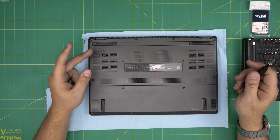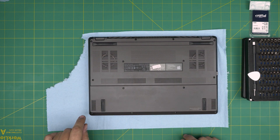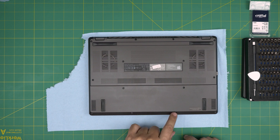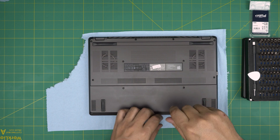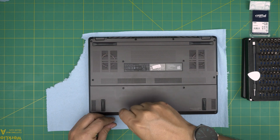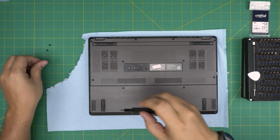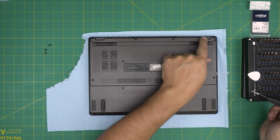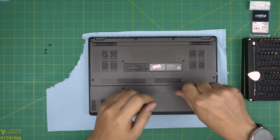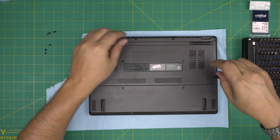On the bottom of the laptop you'll see a bunch of screws — there are two types: long screws and short screws. With the front of the laptop facing you, remove from the left side: one, two, three — remove those three short screws from left to right. Leave the right front screw alone. Now remove the rest: four in the middle, the side, and the back row. These are the longest screws. Keep the two types in separate piles.